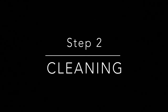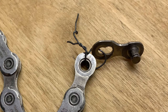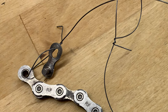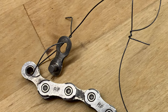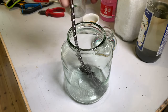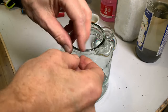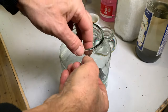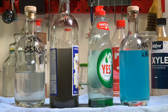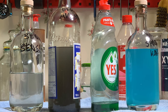Don't forget to refit the brake pads if you removed them. After removing the chain accordingly to the manufacturer's advice, secure all parts that are meant to be used again to the chain. Use a piece of thin wire and a longer one in the other end. Lower the chain in a suitable jar and start the cleaning process. Thorough cleaning is essential to succeed. Bikepun's laboratories use gasoline, degreaser, dish detergent and finally alcohol, in that order.